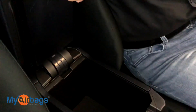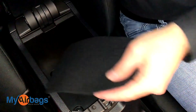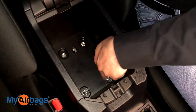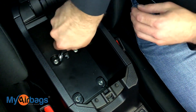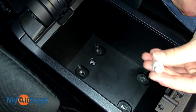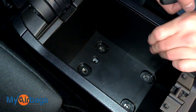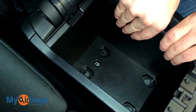Next we're gonna get right inside the car and go into the center armrest here and just lift it up like this. There's a little fabric here that you want to remove, and you'll see there are four bolts right here. I'm going to remove them with a 10 millimeter socket. You want to put those bolts somewhere safe where you won't lose them.